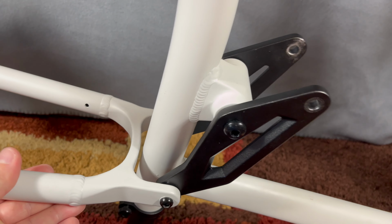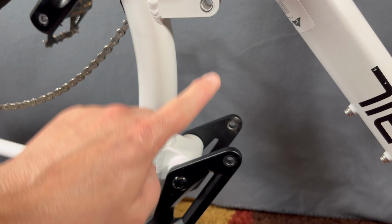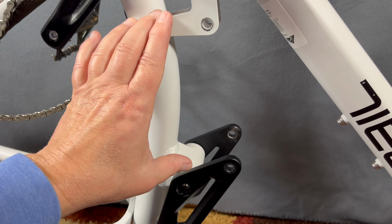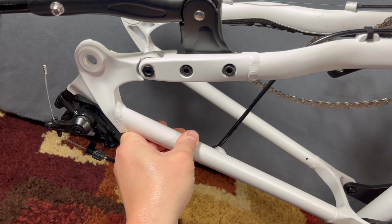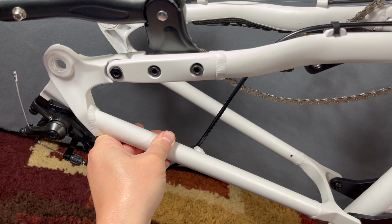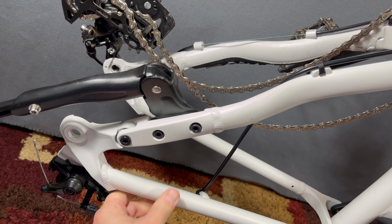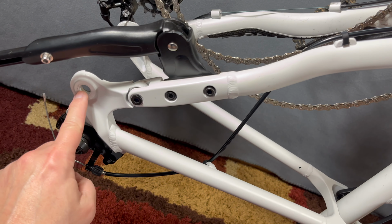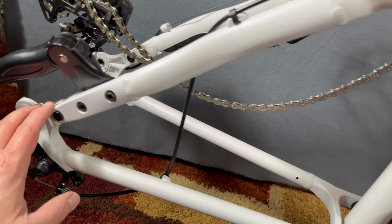I mean, obviously, you don't want this slamming into the back of the seat tube and the full travel out of the shock. Well, you're just not going to get that out of this. But going from 185 to 137 here, so a full 48 millimeters of travel, when I measured at the back how much swing that made, it went from 550 millimeters to 450 millimeters, measuring from the ground to the center of the axle, and that equates to a 1 to